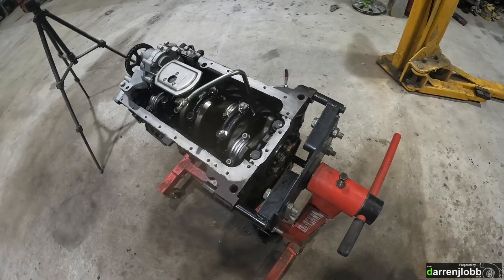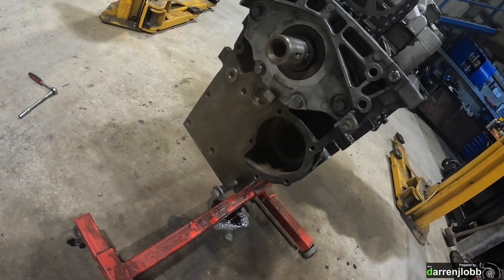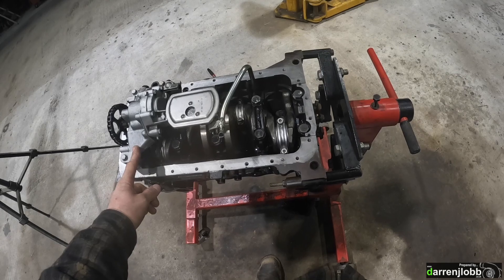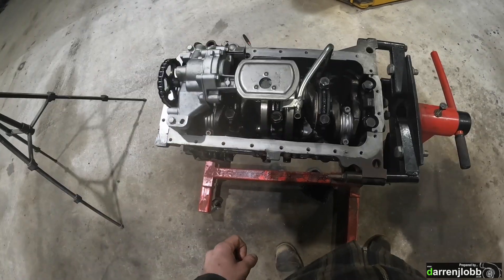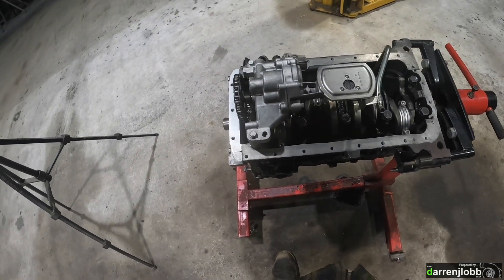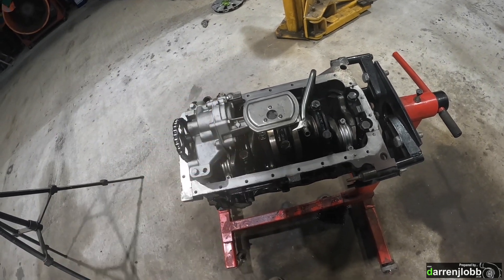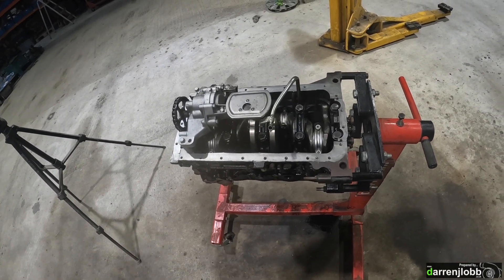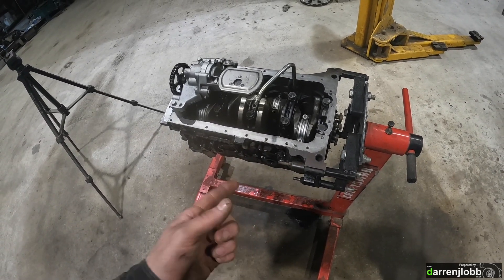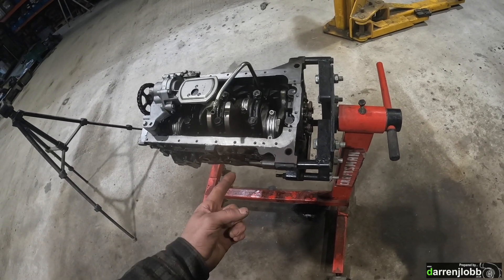Hopefully you've just seen me putting that together. We're at the stage now where I'm going to put the sump on, then take it off the engine stand to do the crank seal. We've put a new seal in the cover, rods and pistons are all in, everything's torqued up, new bearings, new thrust washers, same oil pump bolted down. I've given it a once over and checked the clearances — I knew we should be okay, but it's worth checking with aftermarket rods that you've got adequate clearance around your oil squirters and at the bottom of the sleeves. All good. One final inspection, I'll clean the sump up then get that sealed and bolted down. Then we take it off the stand, flip it around and measure the piston protrusion to get a head gasket ordered.